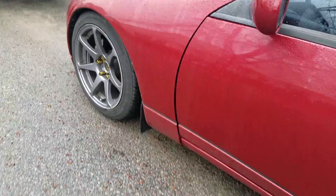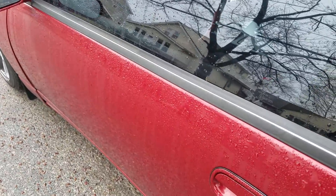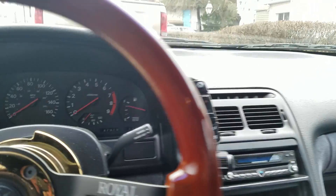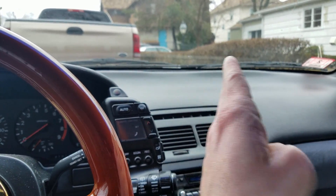They actually ride pretty well. I do notice they are pretty soft — I have them on a setting of 16 out of the 32 levels of dampening. Basically all I did is turn the knob all the way to one side and then went back 16, since 16 is half of 32. Now since it's been about a week riding on the coilovers, I'm going to start turning the damping up a little bit more toward the harder side. I'll probably go up another eight — from 16 we'll go to 24 — just to see how it goes. I have to take the rear plastic parts off again to do that, but I'll be doing that soon.